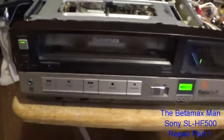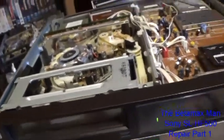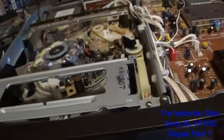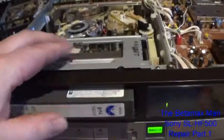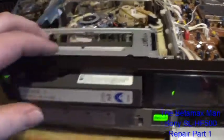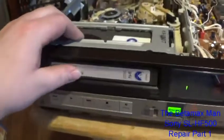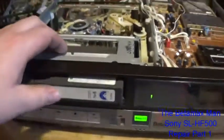Okay, it's powering on. Now let's find a tape — my trusty test tape. Let's see if this cassette housing works. Wow, okay — it's not even going to attempt to load the tape. It's not even attempting to load the cassette. We do have proper power, but now we have no cassette loading, so let's try to find out what's going on.